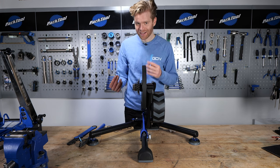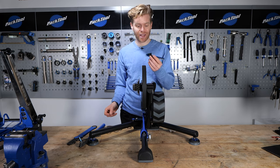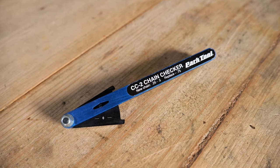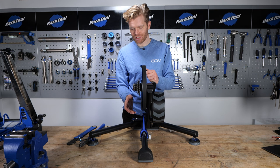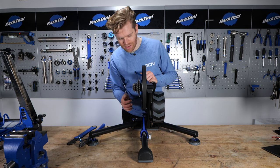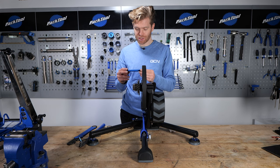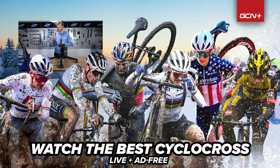Just to reiterate — and I know that people do this — use a chain checker and check that your chain isn't stretched. Visually inspect the cassette on your bike as well. It's easy to keep this nice new one clean and unworn that's on the turbo trainer, but if the one on your bike is a bit tired, just have a look at the ramps and all the little teeth and see that they're not worn and they don't look like a shark's mouth. You should be good to go. You can check your chain with a Park Tool chain checker like this — really useful bit of kit and something that's well worth having in your home mechanic toolbox.